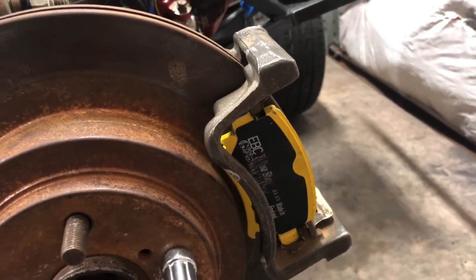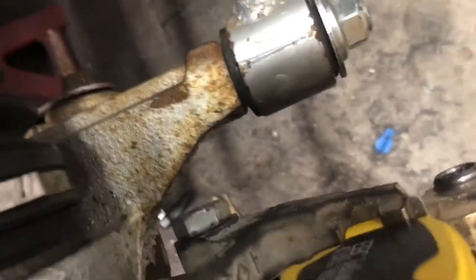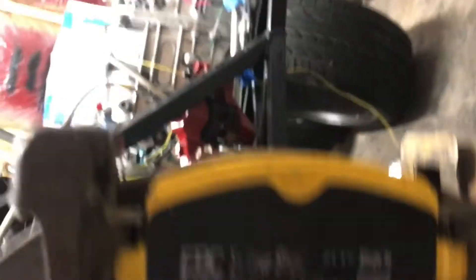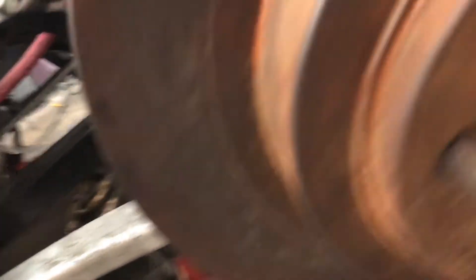It's taken two weeks but I finally have a caliper mounted on the rear wheel. I still need to do a little clearancing — it's really tight right there and it's not spinning freely. Also where I welded my nuts on the back of the backing plate it rubs just a tiny bit, so I'll have to grind off the corner of the nut. But the pad sits in there nicely, even with the edge of the rotor. Here's the caliper bracket — I'll put the caliper up on there next.